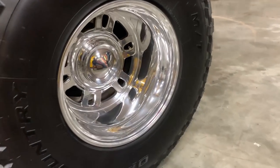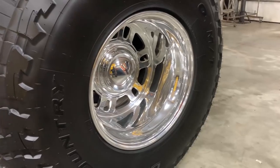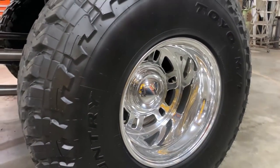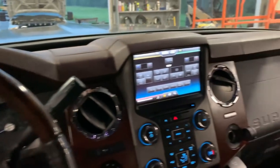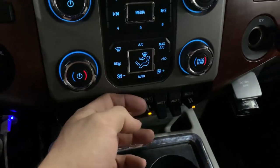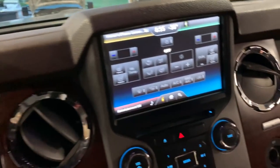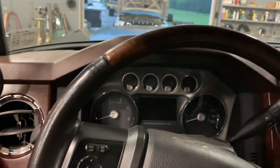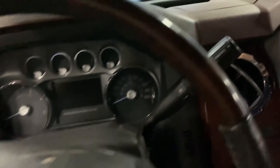For the wheel and tire setup, these are 17x14 Weld Mountain Crushers. I bought them originally as 17x10s, sent them off and widened by Weldcraft, then CJ gave them a good polish. These are 40x13.5 Toyos. For the inside, I have all the luxuries of the 2014 minus the power windows for now. All the AUX switches I have hooked up to the fan, rock lights, all the factory harnesses are there. AC seats work, heated seats, all the factory dash — everything works. Everything is hooked into the factory harness. Not much cutting was needed for the factory wire harness because the truck was still running and driving throughout the whole build process.